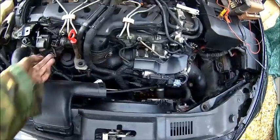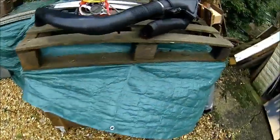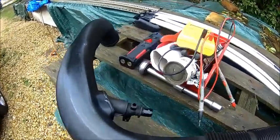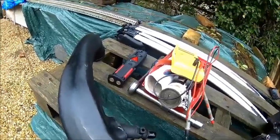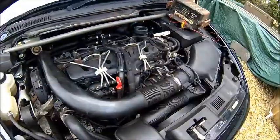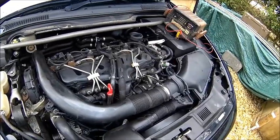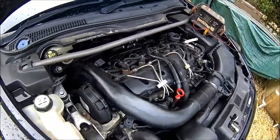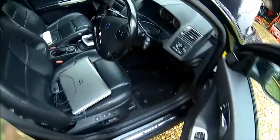Don't forget the mass sensor when you put it back, otherwise you may have an issue. Also, this plug goes to the bottom here. Everything is really oily here. Okay, everything back together. Hopefully all the plugs are back, and then we'll give it a crank and see how it works. I'll hook up the diagnostics first so we can see right away what's going on.